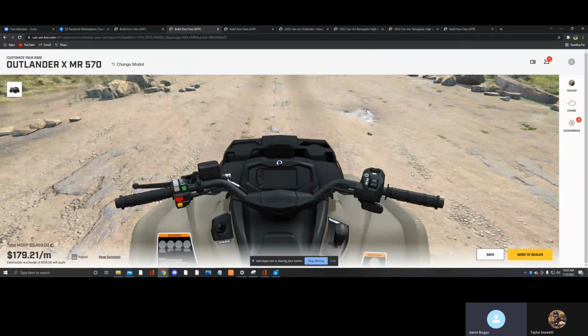It'll only do it in low, it won't do it in high, but if you add in a CVTech clutch kit primary, it will do it in high. I don't know about you, but the clutch kit I would recommend to the people who want it for their 570 is the High Lifter Super Duty Extreme for 570. They are meant for 31-inch mud tires. If you throw it on with stock Mega Mayhems, you will be able to wheelie in high sitting down. Because I think I saw your video and you almost did that. I don't know if you had the same clutch or not.